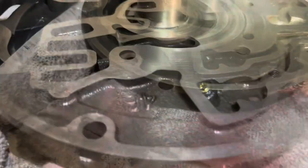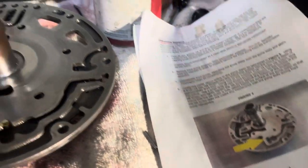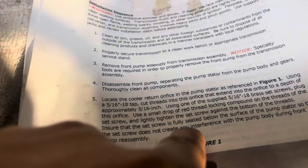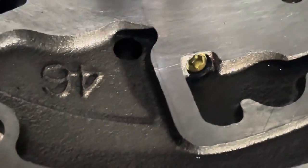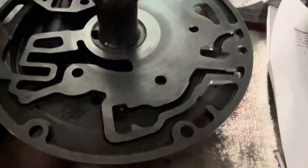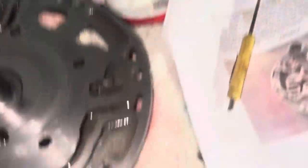About to put the little set screw in this one — this one's in. It says go in like 5/16 — that's just a rough measurement, I kinda just eyeballed it. It was a good guess because all it has to do is be below the surface. The directions say: ensure the set screw is fully seated below the surface of the pump stator so that the set screw does not create inner interference of the pump body. I think that's pretty perfect because it bottomed out and I gave it a little extra. That's where it sits — I'm happy with that.